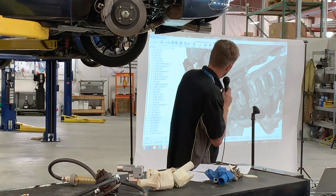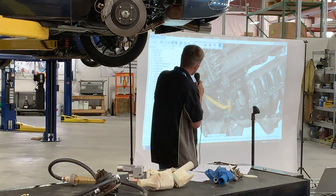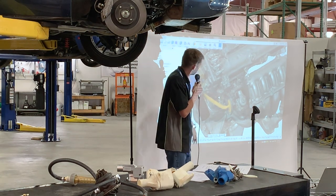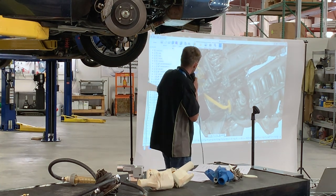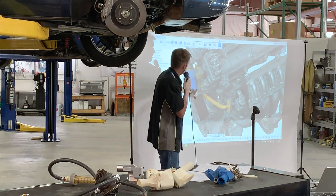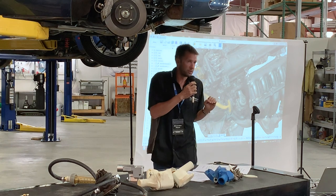It's kind of hard to see, sorry about that. And it's now occurred to me that I can't operate anything with just one hand. But you can see what's going on here. This is a 3D scan of the engine. It comes out a little weird, but it's still fairly visible: a cam angle sensor, coils, EGR valve cover, intake manifold, and so on. So this is obviously the final design. There are all sorts of iterations in here, but you can see that we've got everything designed. We've got the EGR pipe in here so we can carefully design the reroute around the EGR pipe to make sure that everything fits appropriately.